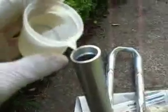Right, I'm emptying the rebound cartridge, so I've taken the thing off, and then you push the damper rod in and out a few times, and all the oil comes out into the pan. So fill that up with oil first and go from there. Right, in goes the 50cc of oil. Doesn't seem very much to me, but we'll see how it goes. And then you put the shim stack in for the TST control. Make sure we do that up enough now so it doesn't undo like it did last time.